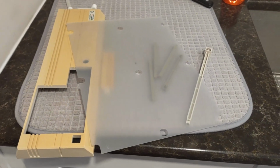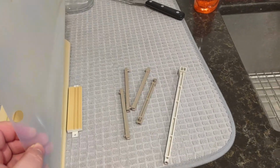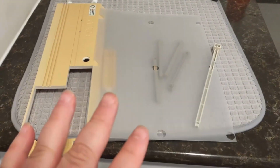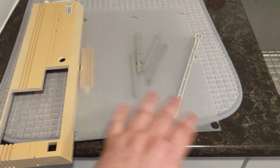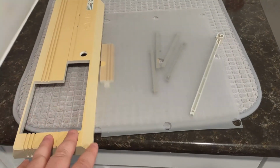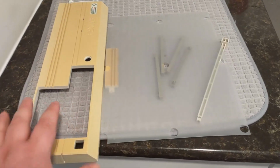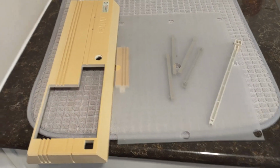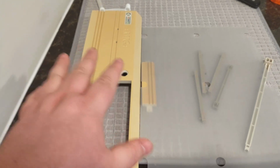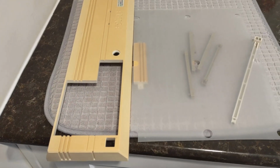We're back here in the annex to the lab, also known as the kitchen. And I've washed all the plastic pieces related to this Amiga 4000, just using regular dish soap and water. And I'm letting them hang out here to get completely 100% dry, so that I can reassemble them. I'm sold on washing old electronics like this because over time so much dirt and gunk builds up onto them. They felt dirty to touch before, and now they feel clean. I'm not going to retrobrite this till I get everything working. And even then I might not. I just don't know about the retrobriting.